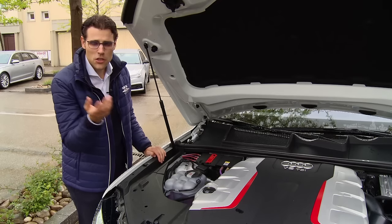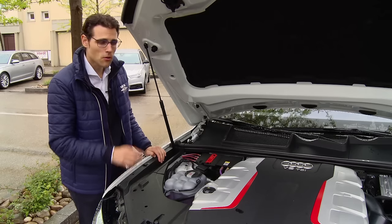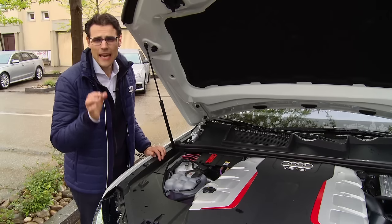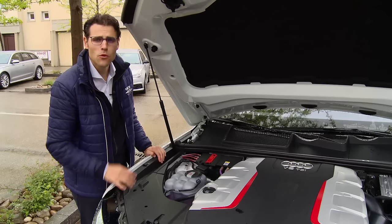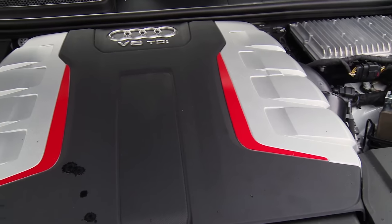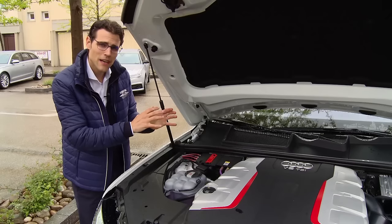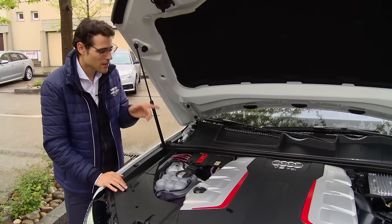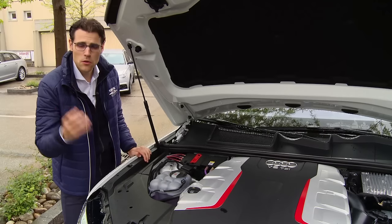The standard 12V power chargers for smartphones and accessories will still run on 12V, as will the windows. The experts say it will remain at 12V for those easy systems because 48V would be too much. But this also gives us a view toward the future — with the electrification of cars, internal power systems will rise. We will partly see those 48V systems in future Audi models and other car brands.